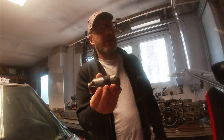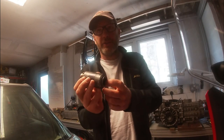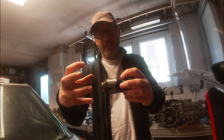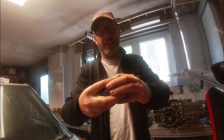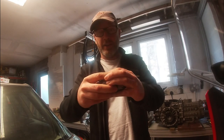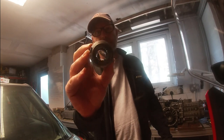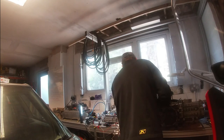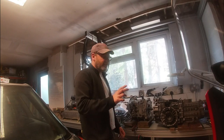You can get bespoke ones where you'd broach the proper spline sizes and broach a couple either side and they kind of interlink like fingers. In between you have polyurethane bushes so there's a bit of give. But for the moment to get us going, this is it. Put that back in — all fits together, lovely.